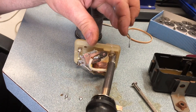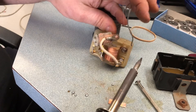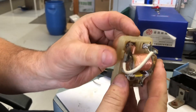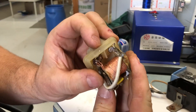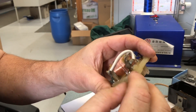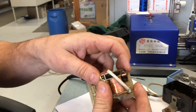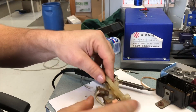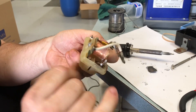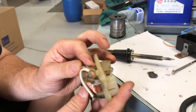I'll put a bit more solder in — should be boiling off any of the corrosion and the oil and the crap on there. Okay, so that's my new contactor — solid copper in place. We have a mechanical connection holding that in place now, and we're going to fill it with solder to give it an electrical connection as well. That's now a good connection — we've got a nice solder fill, a polished section there and there, and then we rejig the relay.